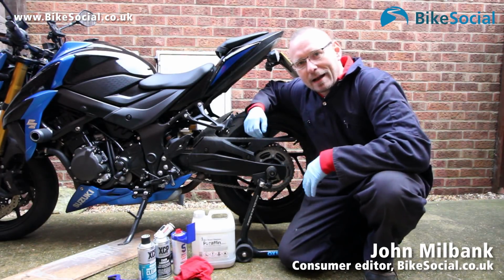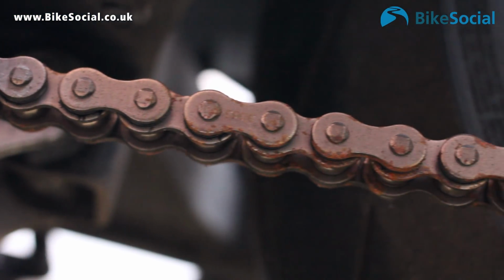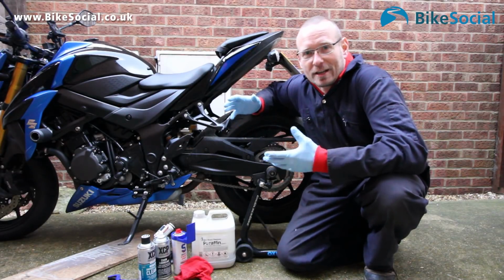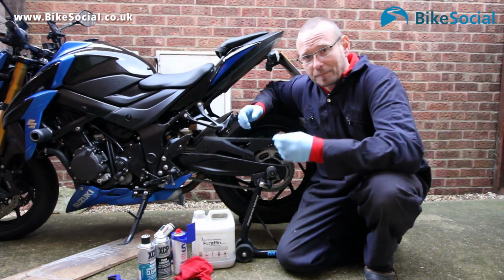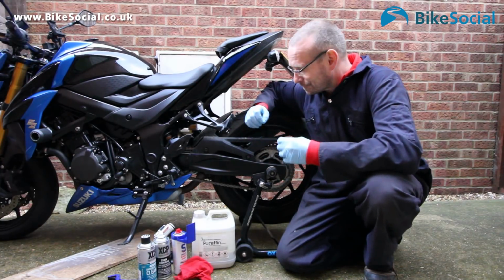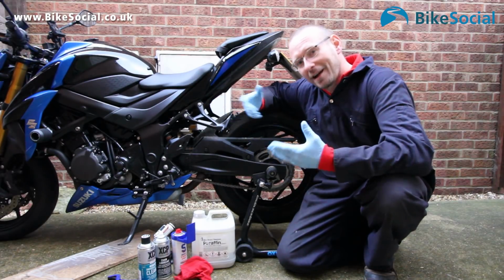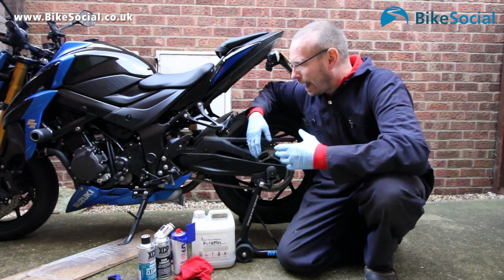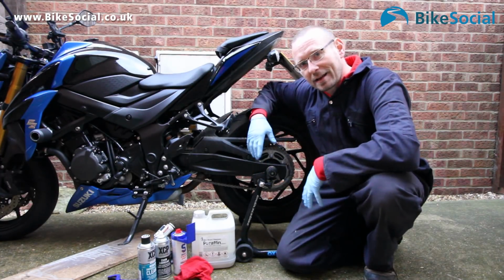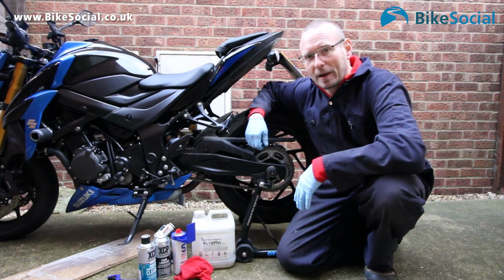In this video I want to show you how to properly clean and lube your motorcycle chain, but also what you can use to clean it. There's two types of bike chain. The larger capacity bikes generally have what's called a sealed chain, which has O-rings or X-rings between the plates on the rollers. Now these are a continuous loop, and because they go around the swing arm pivot, you can't take them out without cutting it. Some smaller capacity bikes will have a split link, and you can take that link out and remove the chain to clean it, but to be honest, it's so grubby and cleaning it really isn't that hard. You might as well leave it on the bike.